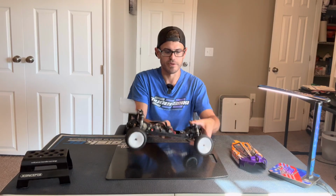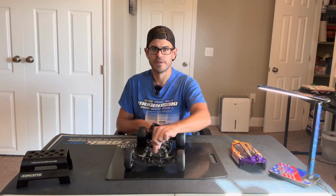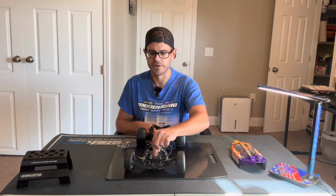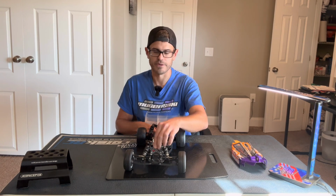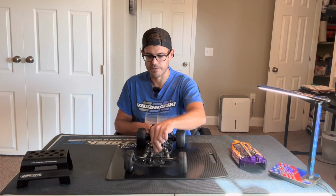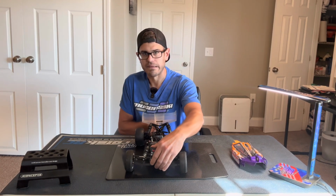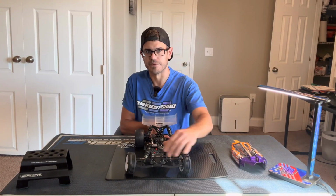The idea though is you don't want any bump steer, and what I mean by that is when I compress the suspension, that's the front tires wanting to turn in, or I guess turn out too. So I just want them to stay at a very consistent range as I'm cornering and the buggy is leaning into the dirt as I make it through the corner.